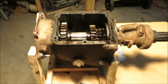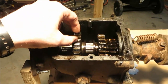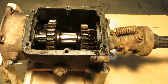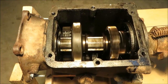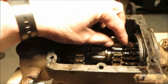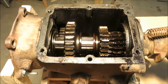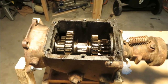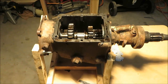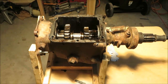That's how a 1928 Model A Ford transmission works. One thing you may have noticed when downshifting is significant gear clash. The reason is that the input drive gears have to match the speed of the output drive gears, or else they will clash. Those who are new to shifting a Model A transmission will find downshifting a significant challenge and may even need to double-clutch from time to time. Hopefully this video has helped you.